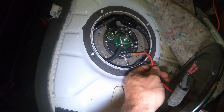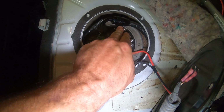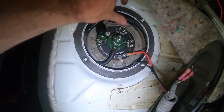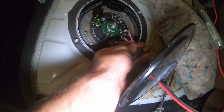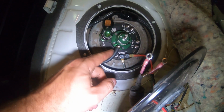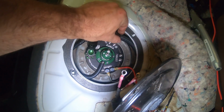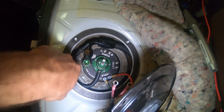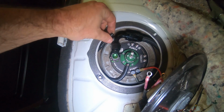We got our new hot wires to one of the in-tank pumps. We only have one wired up right now. The second pump's wired over here. We also have the stock level, 2 ring terminals on them. That's going to go down there on the level section. And we have our boost reference run to the front. This line is pretty tough to get run down the front of the tank, but if you reach down in the front, there's a groove where the stock fuel line runs.